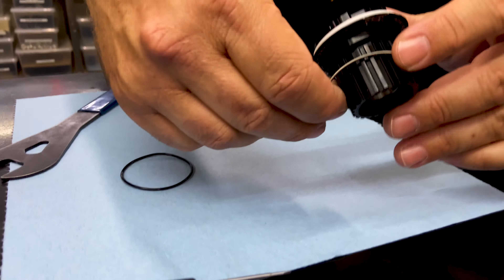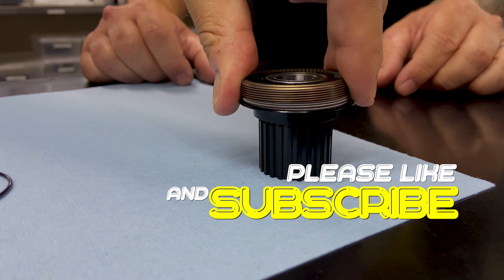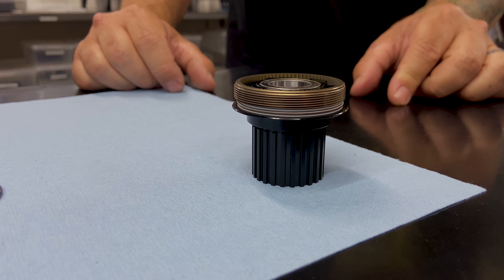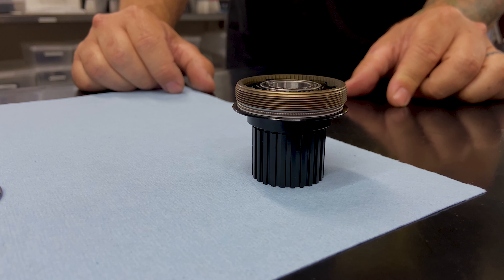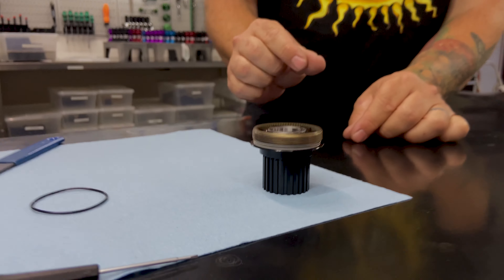When this is installed, the seal will actually bump up and make contact with the driver ring in this fashion. The energizer spring pushes and holds that seal right up against the driver ring. This is what keeps it in contact when the hub is flexed — which happens more than people think when you're pedaling — and also when you make big impacts with your rear wheel. It's a neat design and does a great job when everything is properly installed and in good shape. It is obviously important to get that O-ring and seal in correctly for this to work the way it's supposed to.